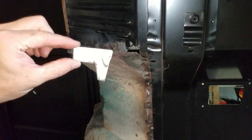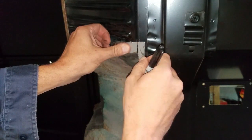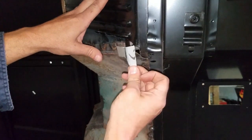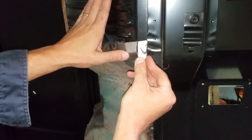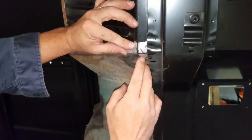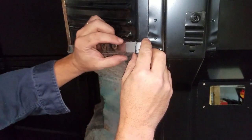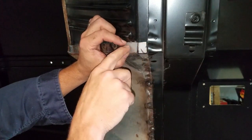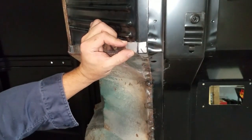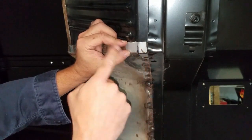Okay, there's my metal piece — I just need to mark my bend right in there. I've got a little bend in it. It's not perfect yet, but we're getting there. I need to bend it right across here, knock a little off this corner, flatten this out a little bit, take a little off this edge. It's really close — I'm going to put a screw in it so I can start working it with a hammer and try to get it closer. It's kind of hard just to manipulate it with a vice and hammer, but we can tap it in and get it welded out.